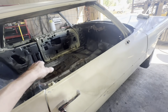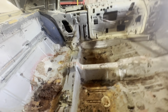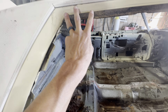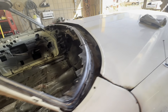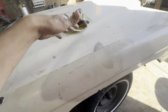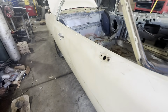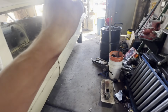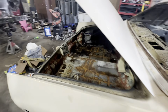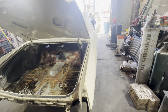But yeah, canoed trunk, stacked door bars. Halo is gonna probably come up through right here and be towards the back side of the car to help the pillars out. We get, I think, just one single front bar, and then we get engine plate, saddle, chain. We're running spindles at this show. We're not running hump plates. And the reason for that is I'd rather have a hump kink than to lose a tire. So we'll see how it goes. I'm gonna get started on pulling the body off and get working on it.